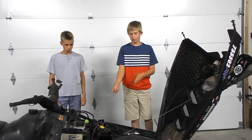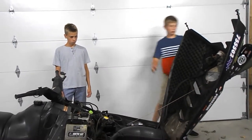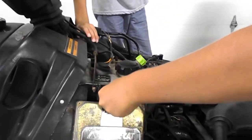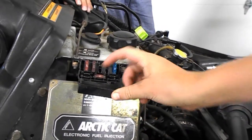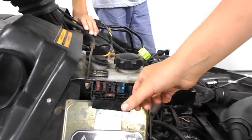Going on to fuel again with EFI — obviously you need a battery to inject your fuel, so check if your battery is charged. If that's all good, then move on to your fuses. This fuse box here — pop it open and look at those fuses; one of them might be blown. They're a dime a dozen, so just swap it out.